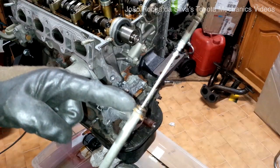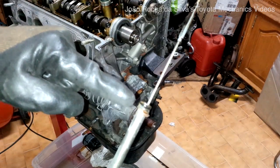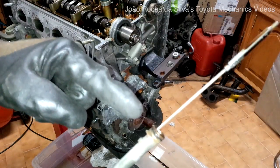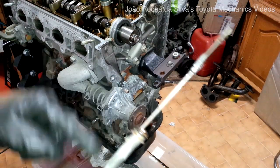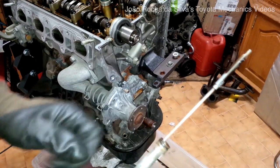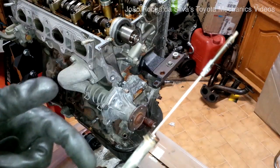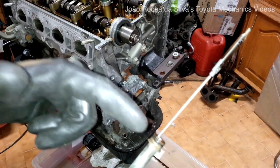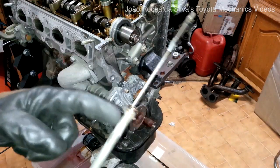Note that there is an O-ring here that will have to be replaced. We will also have to put some silicone grease here to remake this gasket. It's really important because a friend of mine has had some problems with the dipstick connection, and it's because of the lack of this O-ring or a dry O-ring. So we'll be replacing this.